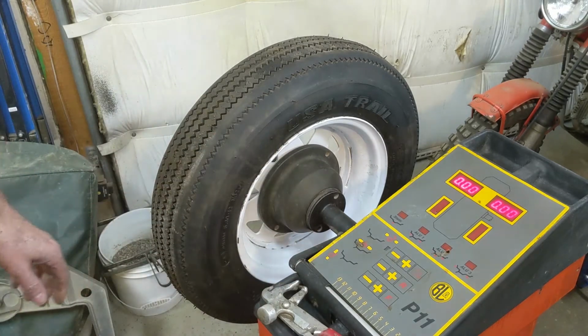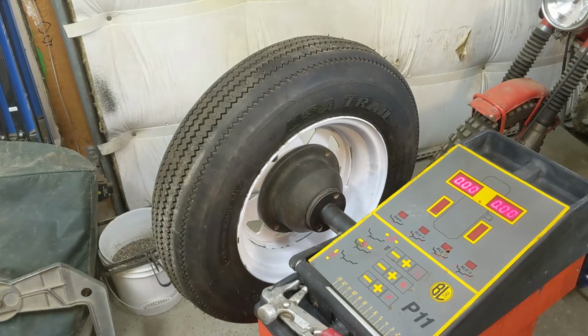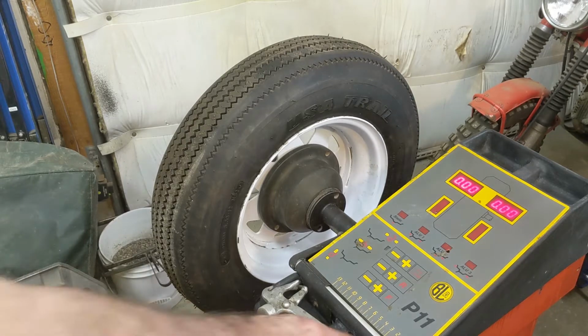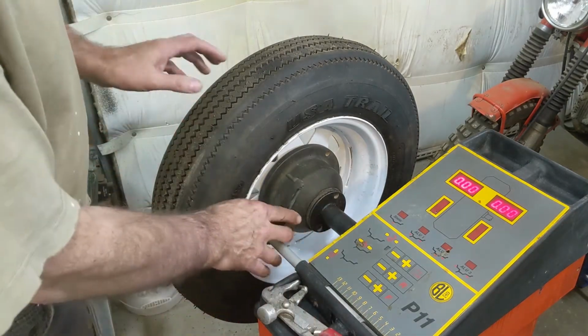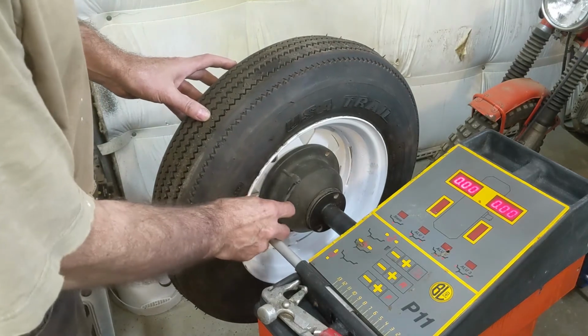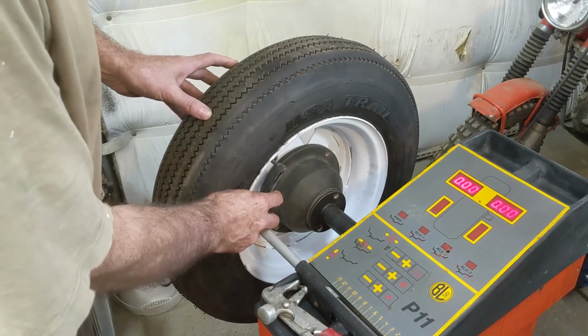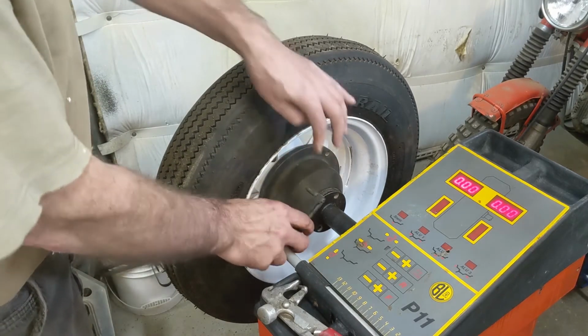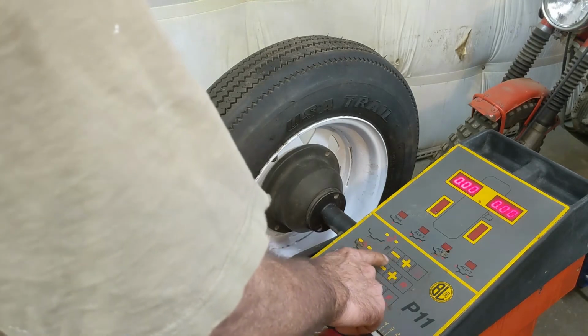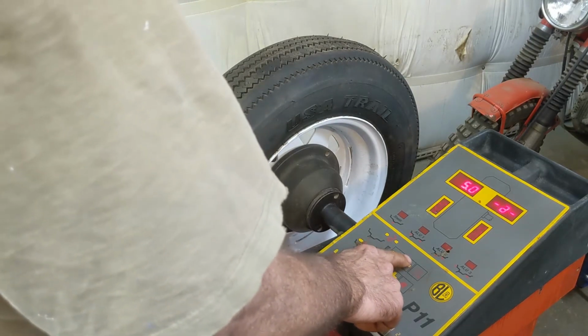Let me hold on. I'll get a measuring tape and see what these actually mean. Well, there you go. I have about 30 measuring tapes around here, metric and imperial, and I go to look for one and I can't find it. So all I have is an imperial one. It's definitely not inches. So they look to me like centimeters. And being made in Europe, it's probably centimeters. I believe you measure to the inside of that lip of the rim by the bead. So I'm going to say 11 centimeters, so I'll set this up to 11.